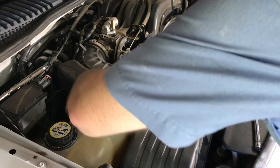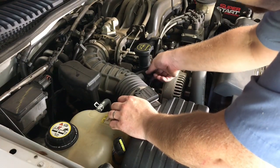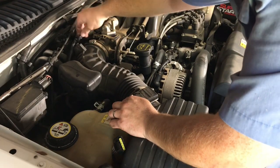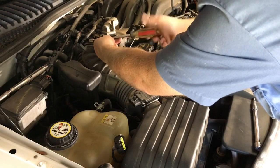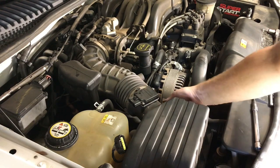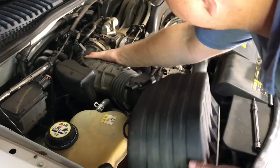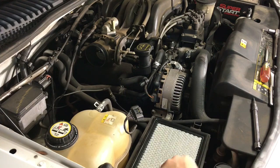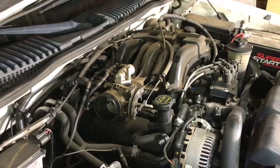Go ahead and unhook the wiring harness for the mass air flow sensor by pushing that tab and it'll come right out. Remove any vacuum lines or PCV lines off of it. There's a clip up here holding a wiring harness — remove those wires from the harness. Take a flathead screwdriver and loosen the hose clamp. Undo the two clips down here like you're going to change the air filter, take the air box loose, and make sure there's nothing else hooked up to it. I'm also going to remove the air filter so I'm not dropping any dirt on the clean side while I've got it off.